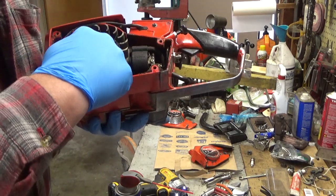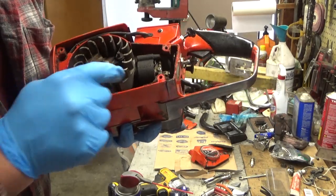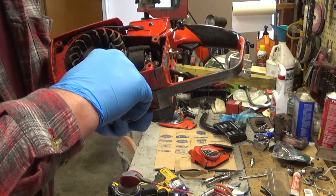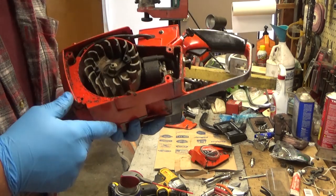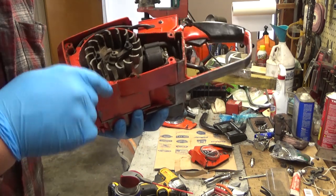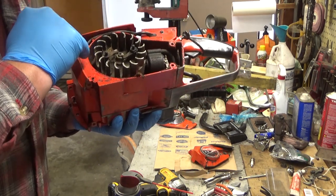It's a Wico system. You're not going to be able to read that in there, but I can tell by the logo, black coil. And it definitely has leaked fuel from somewhere. That's how we got all that accumulation of garbage in there. So this is all going to get cleaned out. And I would say it was from previous.